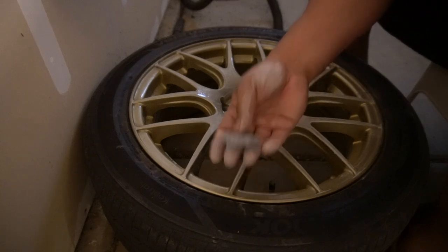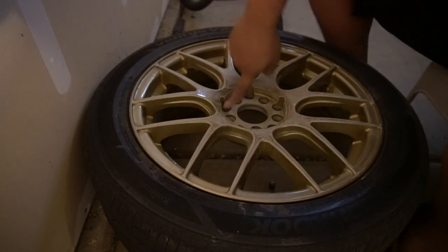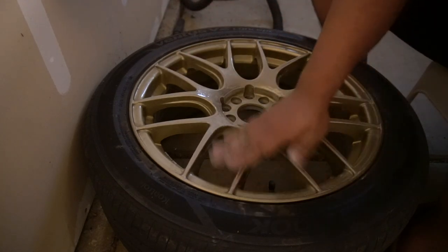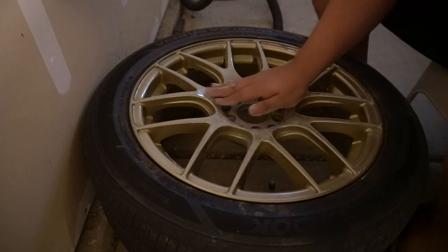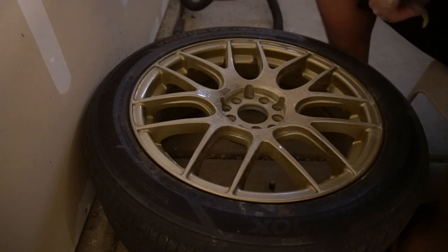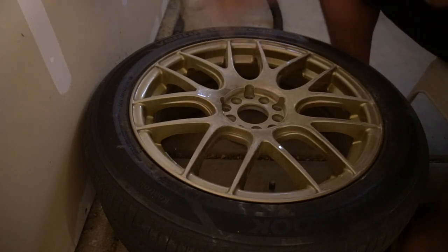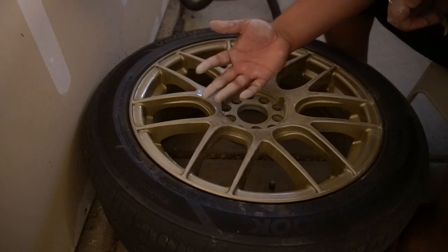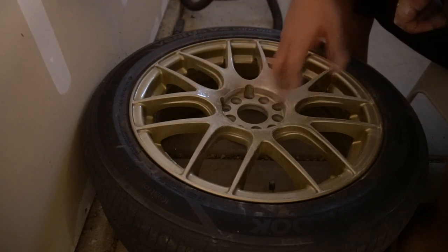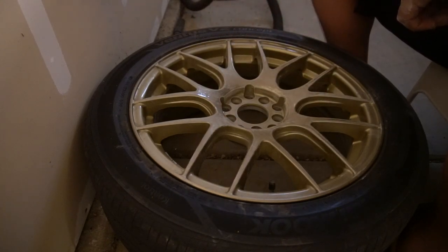As you're going to see, I did cut the larger sandpaper into a little square so I can get to the hard-to-reach places. When you start sanding down, just feel it — obviously if you feel some scratches you'll want to go up in grit, probably like 600 or 400 grit after this, to try to get as smooth as possible. The reason we're sanding down is so when we prime it, the primer has something to grab onto. And of course after the primer we're going to sand that too to make sure we have the smoothest finish possible.